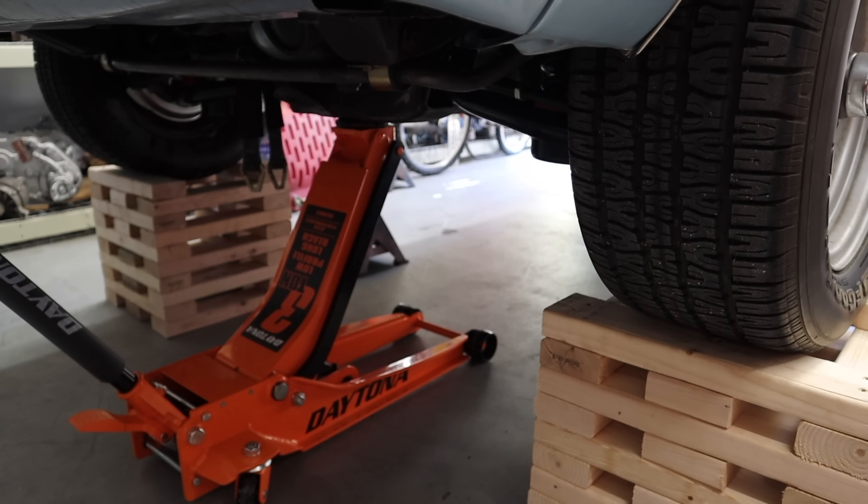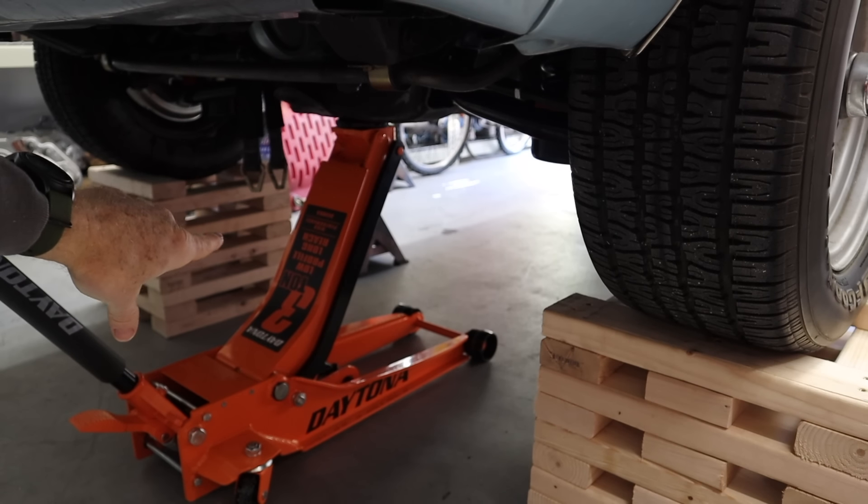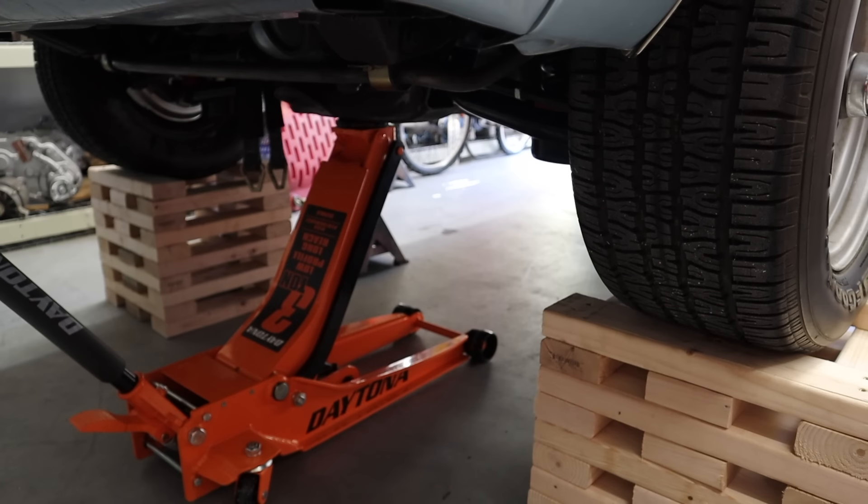The car is now on the cribbing, the cribbing didn't move, didn't shift, nothing cracked — it is looking really steady and stable. I've still got the jack extended under the front crossmember as an extra safety measure, and I've also got six-ton jack stands under the frame in the front and under the rear end in the back. I need to make sure those are extended and positioned correctly before I get under the car. So if the cribbing fails, I've got the jack and the jack stands to back me up.